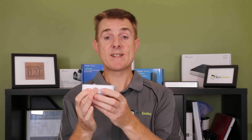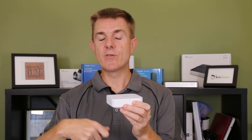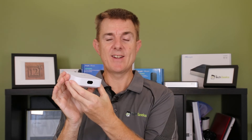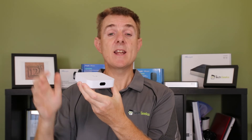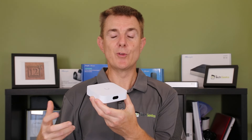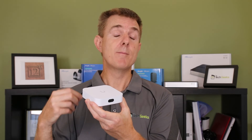Alternatively you can run this as a wired access point on its own — just plug it into the WAN port, plug it into your main network where you've already got a UniFi controller, and it will become an access point. For basic tests, we've tested this on a 500 Mbps connection and it quite happily does 500 Mbps from the internet side. I think that's a limitation of our connection — you might find it does a little bit more, probably 600 or 700 Mbps, maybe a little more.